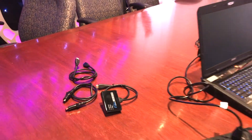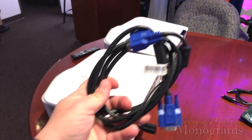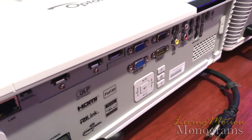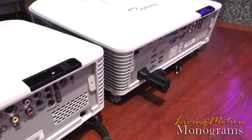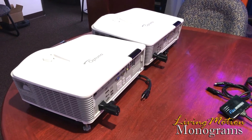You can do this with VGA if you happen to be wanting to use a VGA cable for this, but the catch is that you have to go VGA in, and then you can use the VGA out on the back of the projector to go to your second projector. You do have to go VGA in for the VGA out to work.